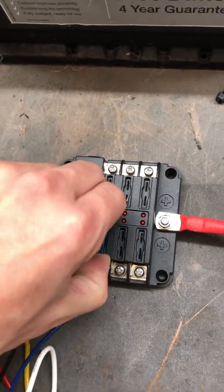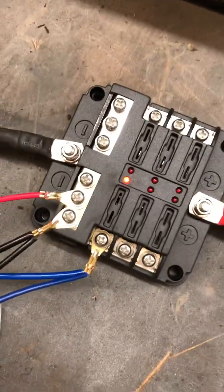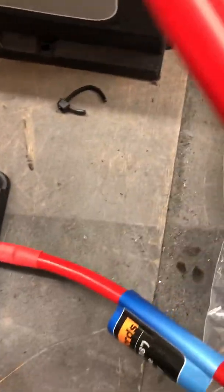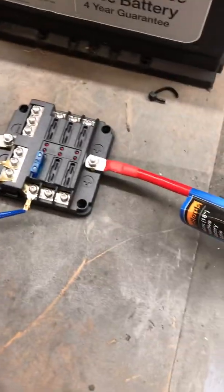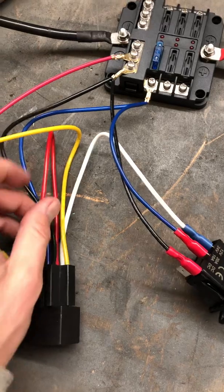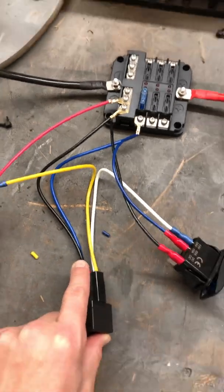Interestingly, this is quite a nice circuit — if a fuse blows, you can pull it out and it will illuminate when the circuit fails, so when there's load on the circuit it makes it very simple to decide which fuse is blown. Hopefully this is helping somebody. You don't need this red wire — the central wire 87a — you can cut that off if you wish, so there are only actually four connections you need to make.